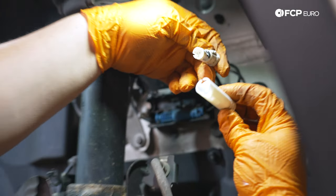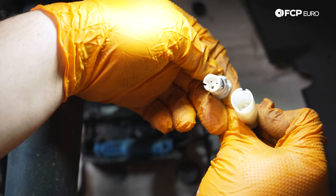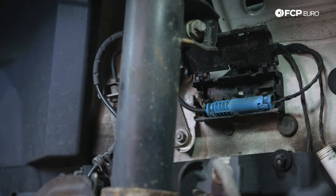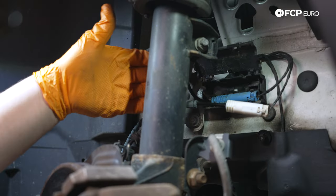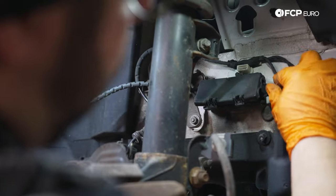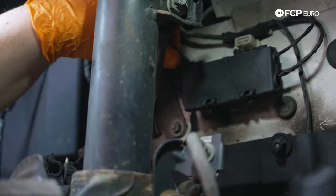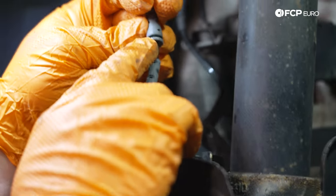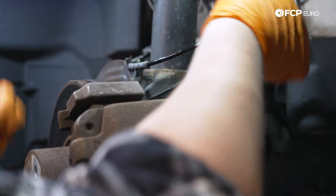Take your new sensor — these are keyed so they really only go one way. Take a quick look at them before you insert it and lock it in. Get the debris out of the junction box and tuck the box back together. Bring the brake cable over — be mindful this cable ran behind the sway bar end link behind the strut, so make sure it's routed the same way when you put it back together. Lock the box up, then seat the wear sensor cable into the first tab just outside the junction box, and then the next metal tab. We're going to hang tight on installing the new white clip and let this hang to the side for now.